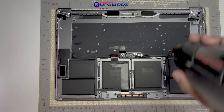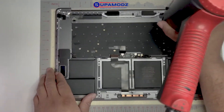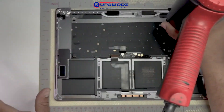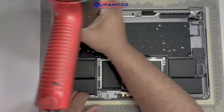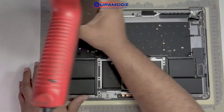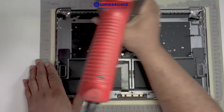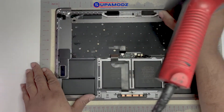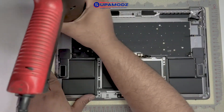We might get some noise. What I like to do is just go back and forth — not staying in one area, just want to keep warming it up nice and evenly. We're going to keep doing this for about maybe two minutes until it's nice and warm. Then we're going to start to work from one side of the touch bar over to the other. You want to make sure the aluminum itself starts absorbing the heat evenly — you don't want it to be in one spot. We're going back and forth, heating it up, and then once it gets nice and warm you're going to see it just come out nice and easy.